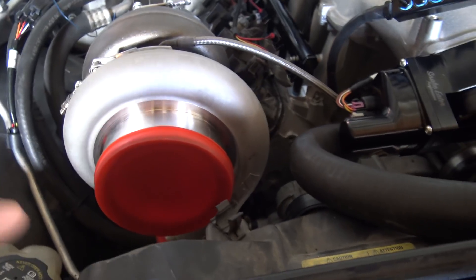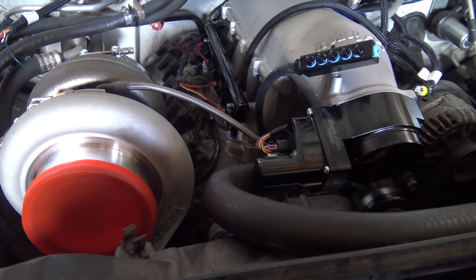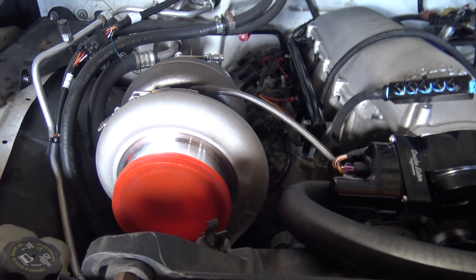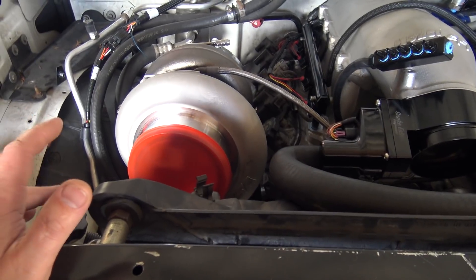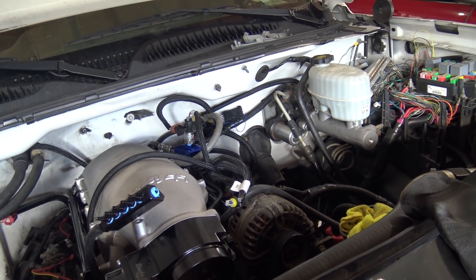Other remaining tasks: double-checking the wiring, getting the downpipe in and building a downpipe. Once Joey comes over, we bolt the divided log on and the turbo is pretty much on for good. I just realized I don't have a T6 metal gasket — I probably have 30 T4 steel stamp gaskets but no T6, so I'm going to grab a 5-pack on Amazon.